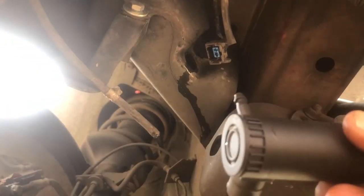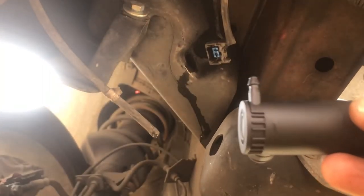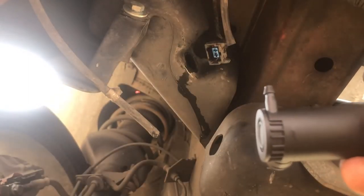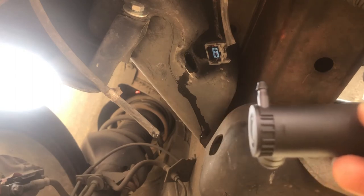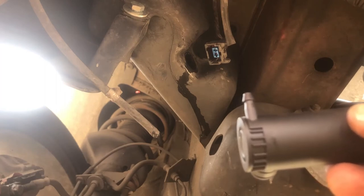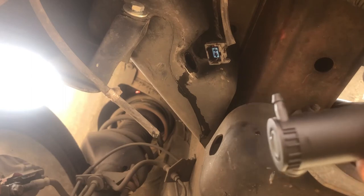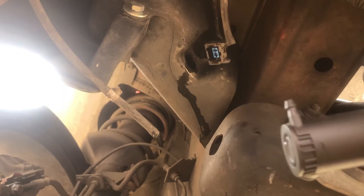Here's the replacement pump, but I've just run into a problem. Because this car is a wagon, it has a rear washer for the rear tailgate window. The part I ordered is from a sedan, so it only has one outlet instead of two. The pump I pulled out had two water outlets because this is a wagon. I really need to send this pump back and get the correct one, but for the purpose of this video, I don't care about the back window since I don't even have a windscreen wiper there. I'm just going to hook it up for the front window squirters only.